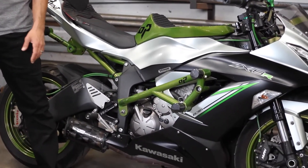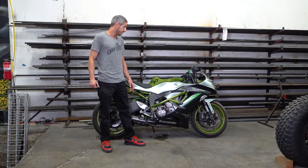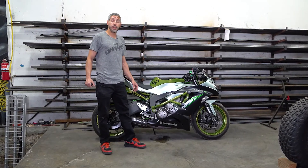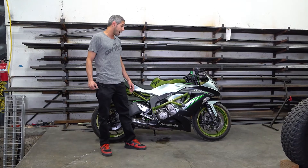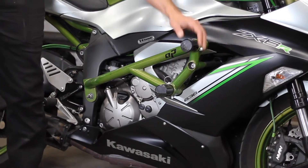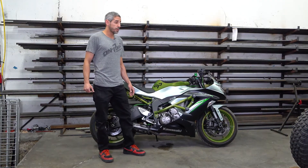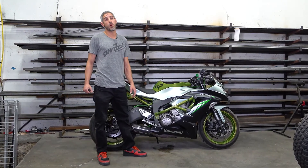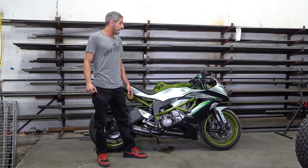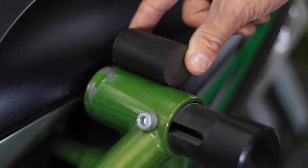These bikes were not designed to have cages mounted to them or to take repeated hard hits from low sides, high sides, or wheelies. These were designed for racing — they have very lightweight frames that are prone to cracking and are overall weak. Therefore we utilize shock absorption to keep those impact forces off the bike. We linked up with a suspension company that builds off-road race shocks and worked with them to develop a material that can handle the weight of a bike falling at speed or from a wheelie.